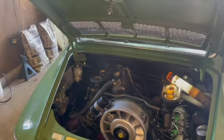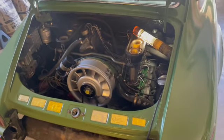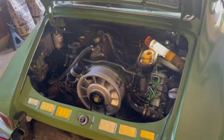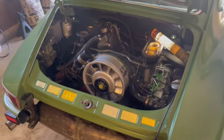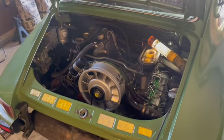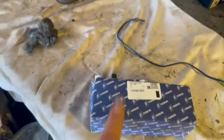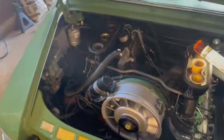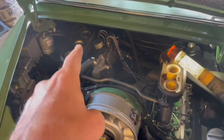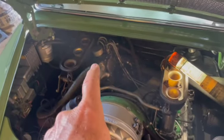Okay, hey, sorry I didn't actually film everything that happened yesterday. A lot of things actually have been happening, but finally got a friend of mine, really good with these cars, really good with old electrical systems, and has worked his way around a few of these MFI units, and we got the Pierberg pump going, making one bar of pressure, and we had everything all dialed in. But here's the fact of the matter: we never could get the pump, that sat for over 40 years, to prime.